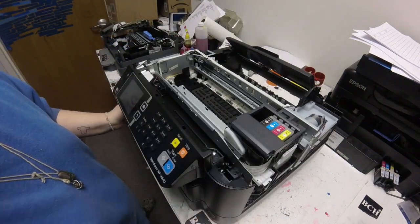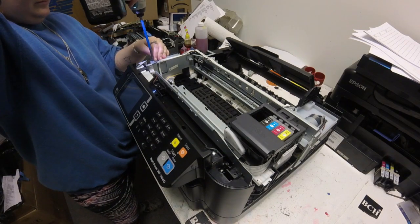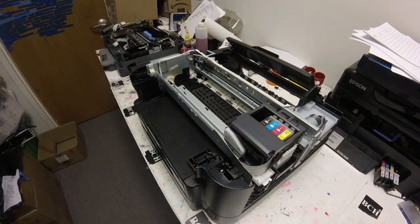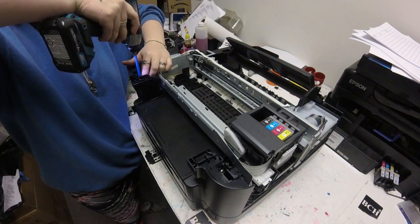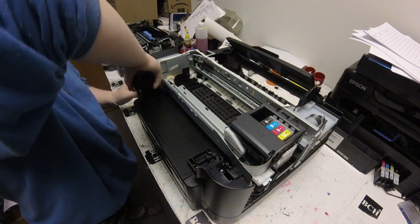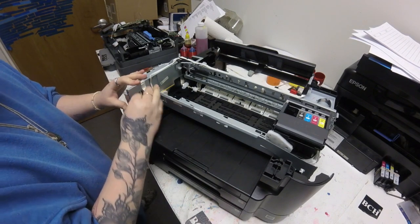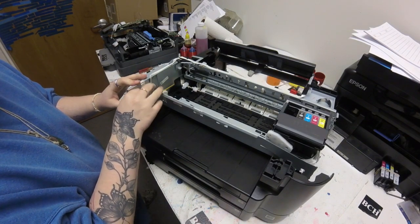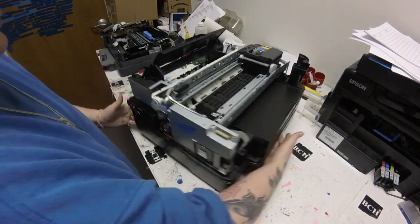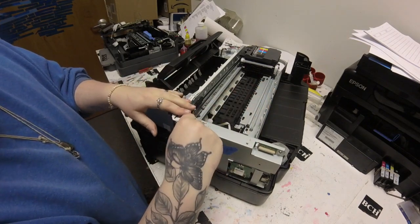Then we're going to focus on this LCD panel on the front of the printer. You're going to unscrew the ground wire on the side of the mainboard, take out that FFC cable, and unscrew the two screws. We're going to focus on that side cover now — take out that deep screw down there, and there's going to be a little tab that you stick your finger on and wiggle that cover off. Then we'll undo these three FFC cables on the side of the mainboard and also undo that thin FFC cable on the side.